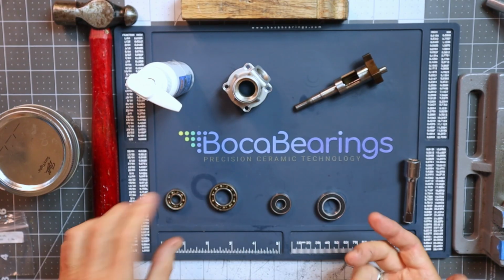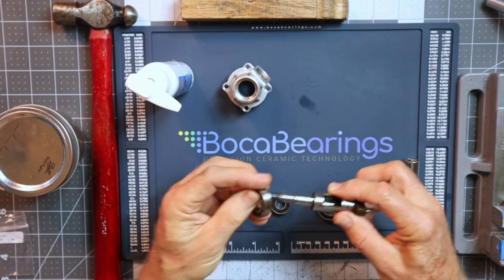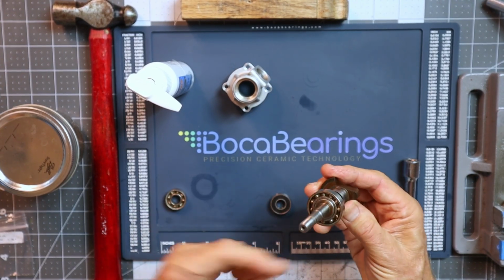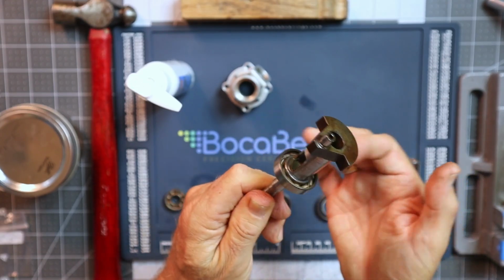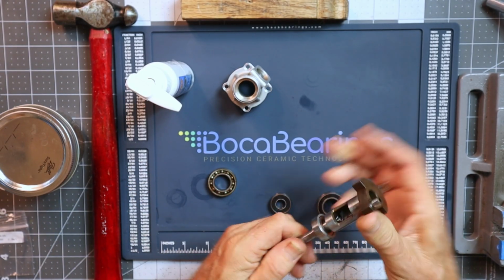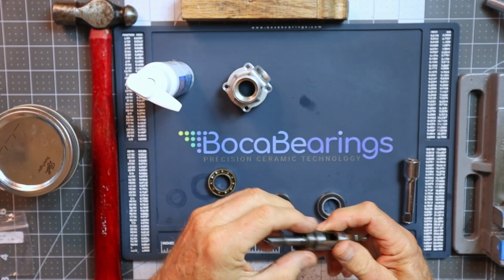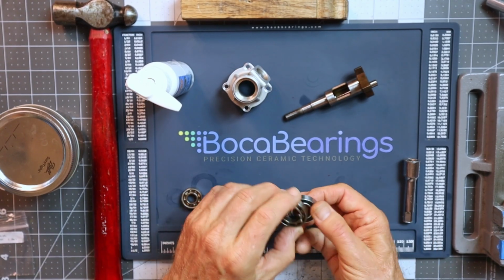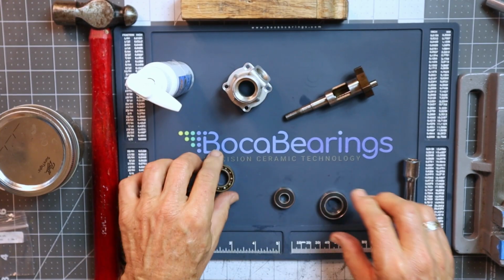Now, one of the things I noticed is in the removal phase, I said these bearings felt fairly decent. But I found that it's really easy to tell here. You can hear, even though this is a low time bearing, I think you can hear the sound it's making. Now, it shouldn't make any sound at all. So both of these bearings still rotate well, but they could probably use a little bit of refurbishment. So let's see here. These look identical, so we're good to go there.